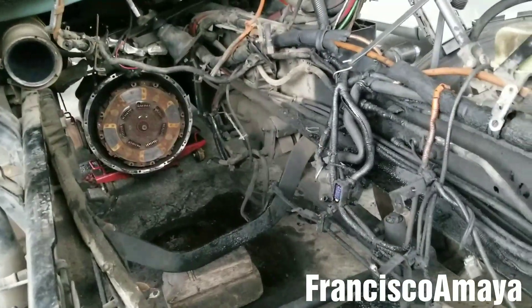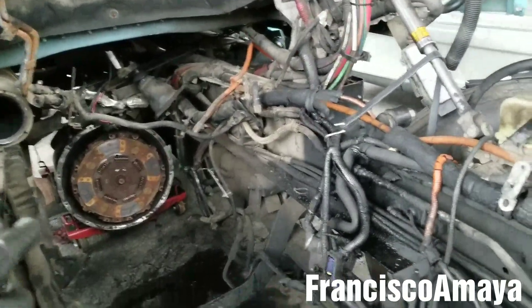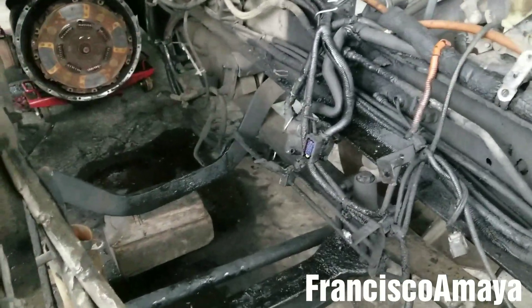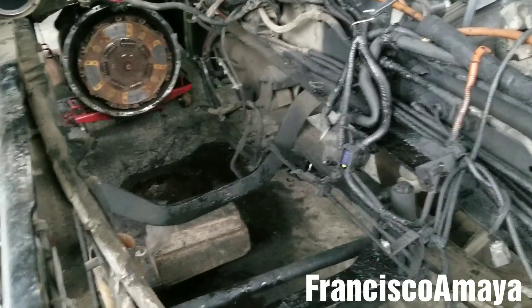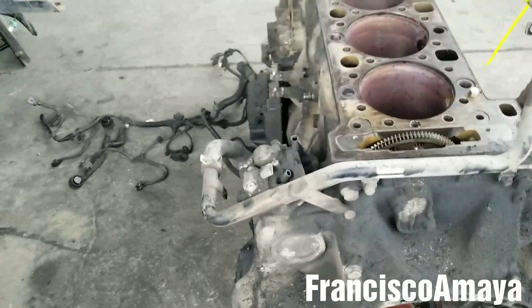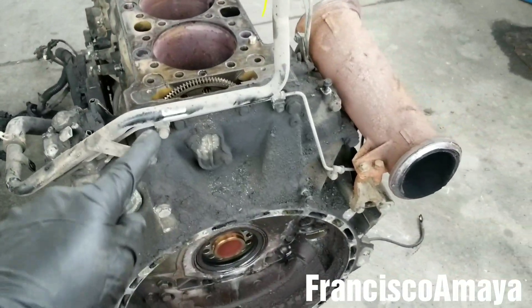Also, if you're planning to do this with the engine inside the truck, you have to drop the oil pan. The oil pan is located underneath the engine — you have to remove it. You can check the corner or end screen of this video for a link to that video as well. In this case, because the engine block is completely out, it's easier, but you have to follow those procedures before you remove the rear cover with the engine on the chassis.